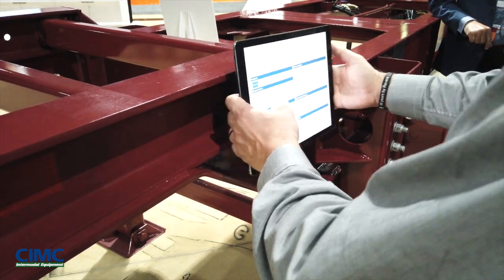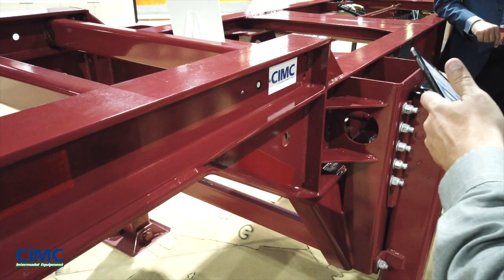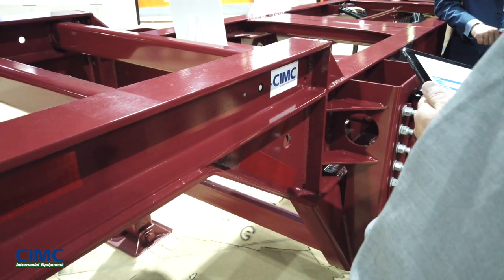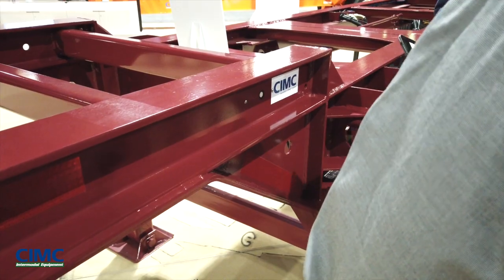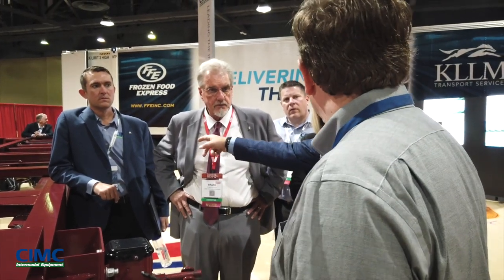It's come back now. It's mated because I showed it blocking the container sensor. On this chassis it shows a short — brown and black — and it shows a license plate issue. So it knows it's either the marker or the license plate. All I did was unplug the right side or left side marker.